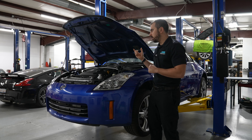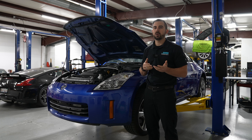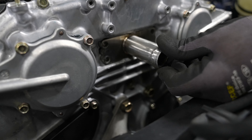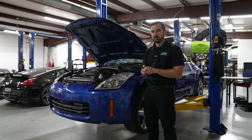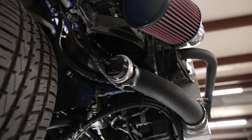The way we made it work is we removed the cooling pipe on the passenger side and basically mimicked a VHR cooling system. You'll see we ran the cooling pipe through the middle. There's a hose that we've altered and adjusted to allow it to work with the stock radiator. That allows us to run the intercooler piping down the passenger side, into the intercooler, out the intercooler, and up into the driver side.